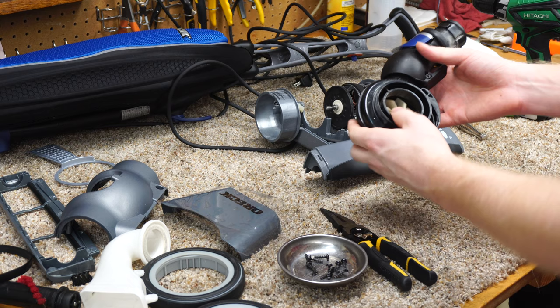Push the gasket on and tighten this up. Hand tight is not good enough on this. The way I'm going to do it is with a strap wrench — Oreck did make a specific tool for doing this, but I just don't happen to have that tool. If you don't have a strap wrench, I'll put a link below in my tools — it's really a good tool to have. Thread the strap wrench on there and tighten it down. It's really important that you get that hand tight and then strap-wrench tight.